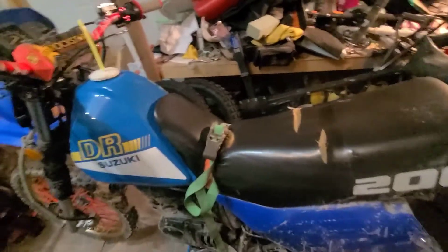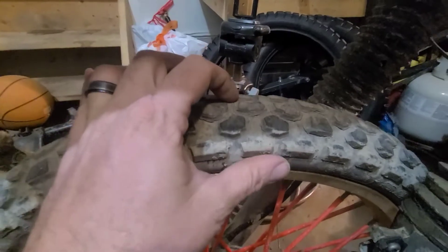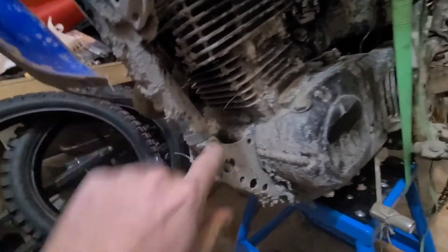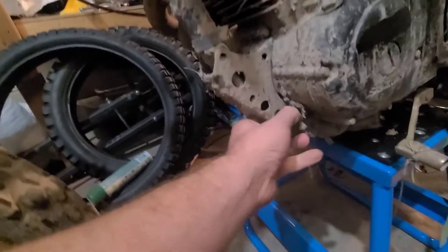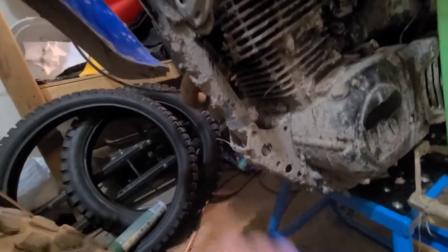Maybe red for stop isn't all that bad though. You can see why I'm changing the tires — they have weather cracks and very low tread so they would never pass the safety. The engine is also not perfectly lined up with the engine mount. This one only has a bolt here, and it's missing two others. This bracket looks like it may be bent, so I've just got to give it a little bend and push it up.